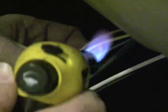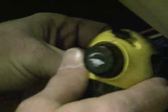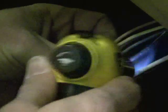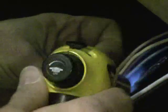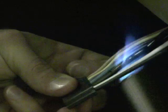Center up the heat shrink tubing. Most of you will use a Bic lighter, a little disposable lighter, which works perfectly well. I have this little torch that's always ready for me, and I just fan the flame over it to shrink it down into place. You have to move it around pretty regular, because if not, you're going to set it on fire. And of course, make sure there's no fuel fumes or loose paper or anything combustible around. You're going to be setting your truck on fire.